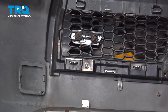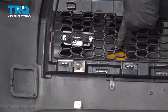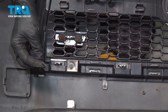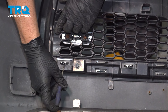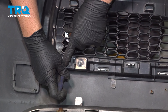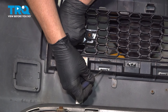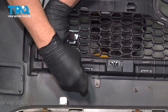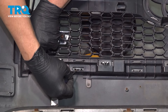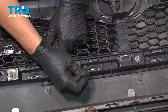Along the bottom of the base of the grille here, you're going to have a series of five tabs as well as some lower tabs we're going to need to release. I'm going to use a small pocket flathead screwdriver. I'm going to come into the bottom middle of this tab, unlock it, and push this in — or out towards the front. The next tab you want to come to is right here; you need to dislodge a little retaining clip here. Then come on over here and work our way down.